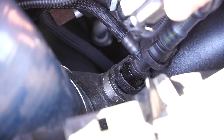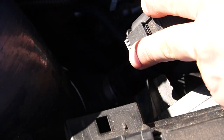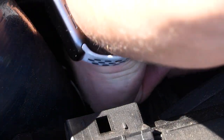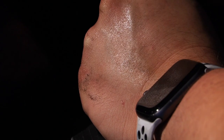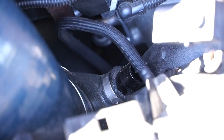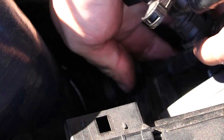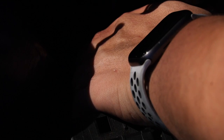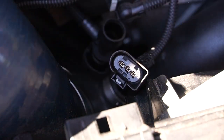This one at the inlet — as I mentioned, he has an aftermarket turbo already so it is slightly different, but the process is pretty much the same. We unplug that, and then this has another one of these clips. We go ahead and unclip it from this very small vacuum line that is attached to the block, and here we have the whole vacuum system out.